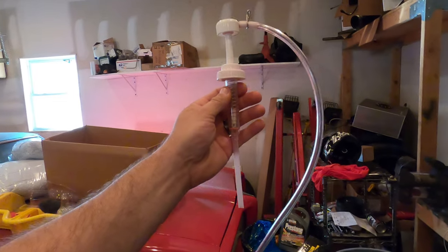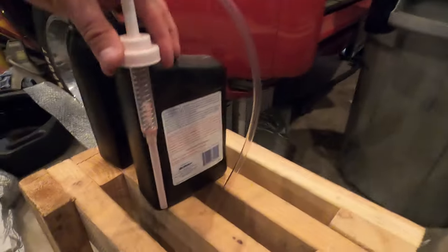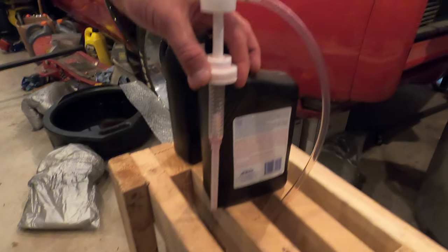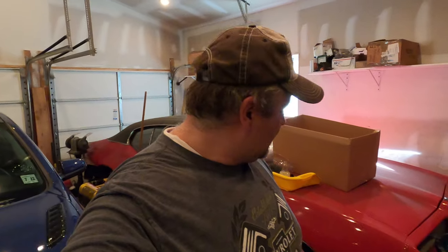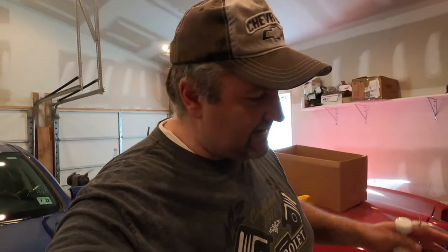All right, so this is the last part. It's very straightforward — I just have a little hand pump here. It's super simple; it has this extra attachment where my pinky is pointing, and it just screws onto the bottle like a normal bottle cap. What this lets me do is bring it up to what the factory would set as the full level in the trans. Like I mentioned before, when you're launching you don't want to expose the pickup, so an extra one and a half quarts — when the car launches the front end comes up, fluid sloshes back, so you want more in there to keep the pump pickup submerged. I'm gonna pull the plug out, fill her up with another one and a half quarts, and then it's just putting everything back together.